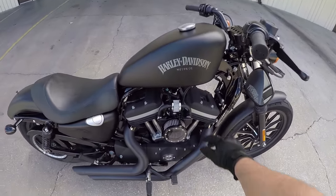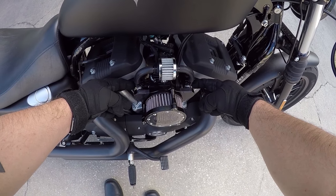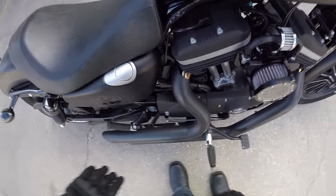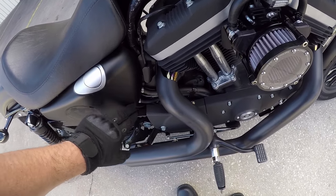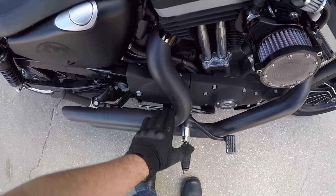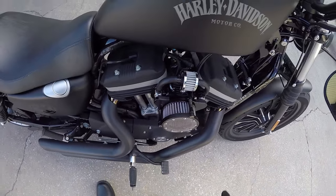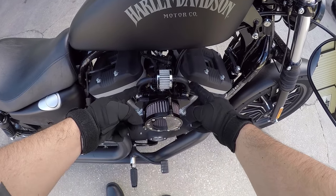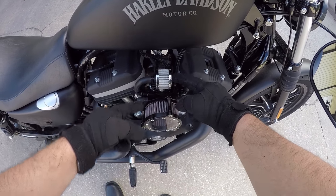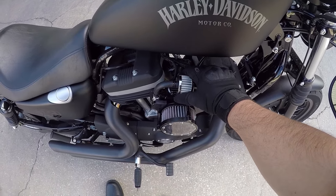So there she is — that's that newness. Beforehand, the bolts would basically let the blow-by come out into the atmosphere, and it would go back and get on the bike. You can see some of it still left over, and on the pipes — it's like a fine oil-air mixture. It would get all over the side of the bike, so that sucked. The fix: still venting it externally, but it basically runs up these hoses and it's not gonna blow all over the side of the bike.